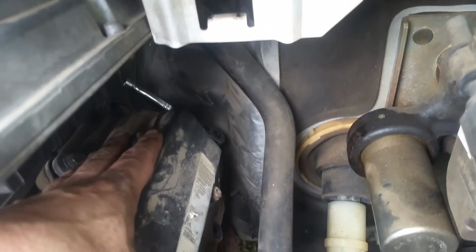Okay, now all these are pretty straightforward to get out of here, except for your very back one back up in here where you can see my ratchet. And I'm just using a little ratchet and a little short socket to get that very, very back one there. And it's kind of hard to even see, but it's right back up in there. And then the other one we're going to contend with is this one right here, where we have our dipstick. We've got a 10 millimeter nut. We're going to have to take that off and then get the 12 millimeter that's below that.